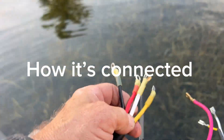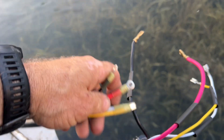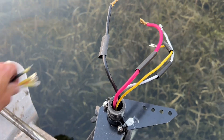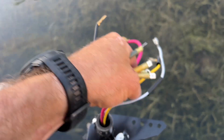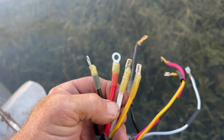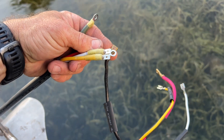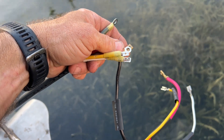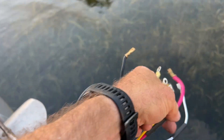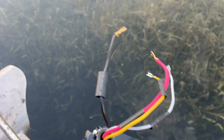The idea is to reconnect these wires that are part of the four-conductor 10-gauge wire and connect it to the motor shaft — negative, positive, and the control wires for reversing. I added heat-shrink terminals on there. We'll get these bolted back on because they bolt to the speed controller, then slide some heat shrink over those and make the connections back at the head for the speed selector. Let's see if this is going to work.